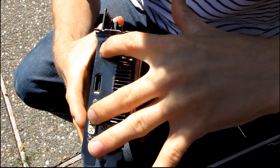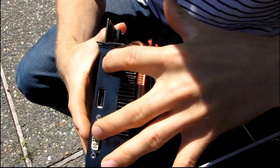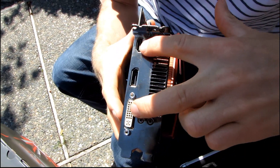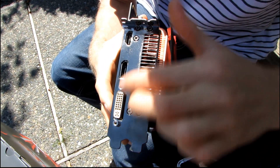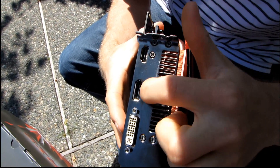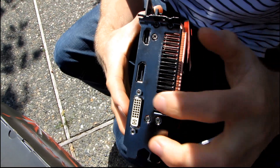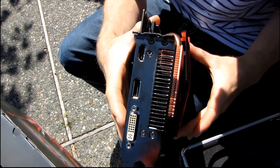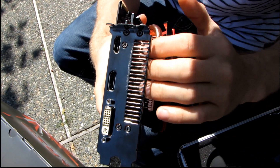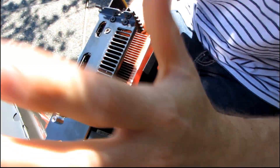We have two DVI and HDMI outputs, so you can hook up two normal DVI monitors just using an adapter. And then we have one DisplayPort port, so you will need to use an active adapter or a DisplayPort monitor in order to run three displays off this graphics card. We've got an empty slot here so that some of the cooling capability of this cooler is going to be blown out the back.